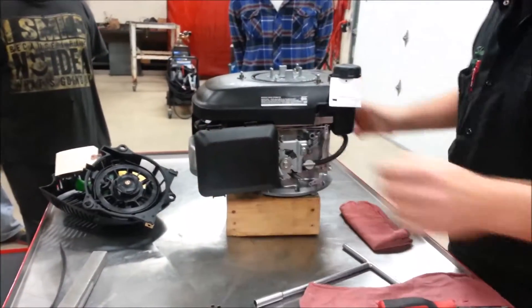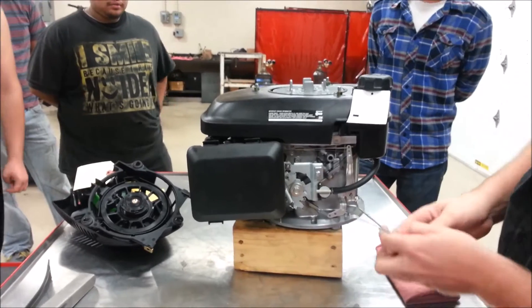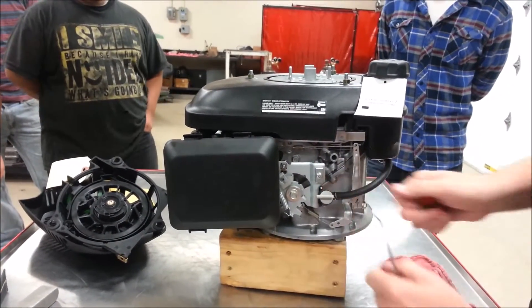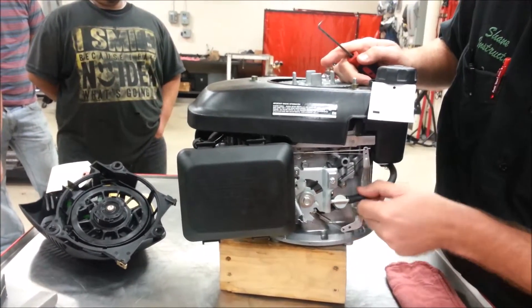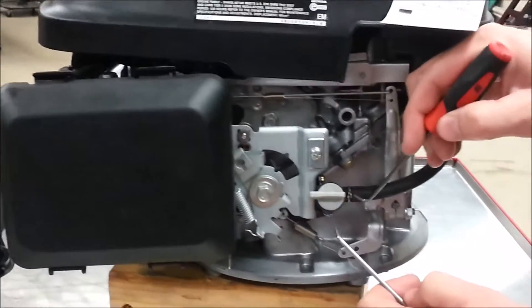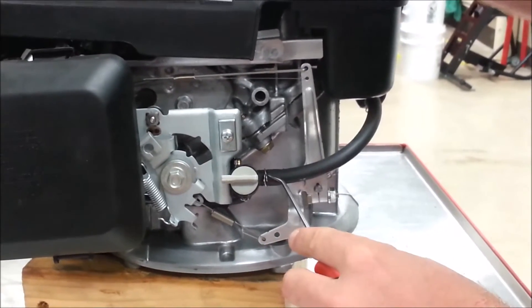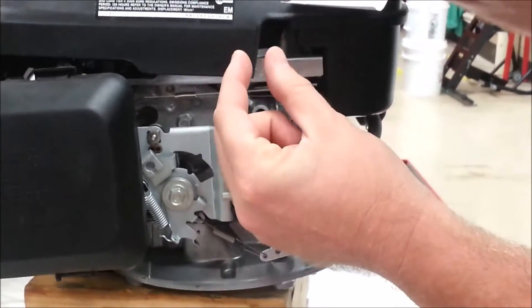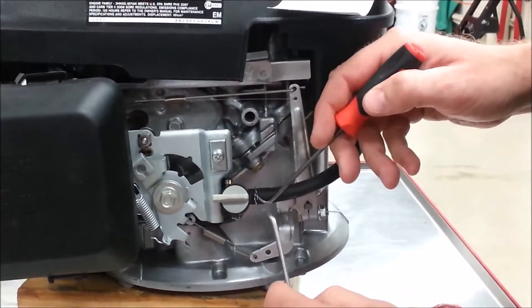On the fuel tank itself — if you guys remember, and you'll see this in the Honda training module — they talk about the hose clamp to pull this off. This is plastic, and if we just go yanking on it, you can actually see in the video how much it's bending. We want to use real caution; it's a one-time-use clamp, if you will. Honda's newest version doesn't use the thin wire clamp — they go to a wide band style, which you'll also see a lot on motorcycles. Just replace them.